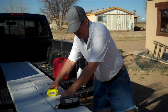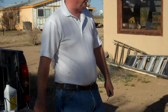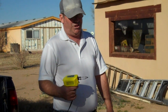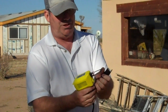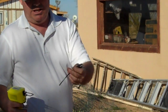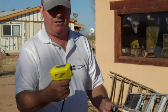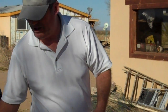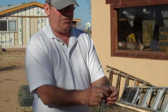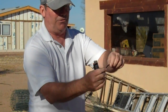Last but not least, when you're in there taking that battery out — or when things are set up and the seat is off and you have access to your battery — a lot of people feel you should go ahead and cut out the fuses and put in a car-style fuse holder and fuse. This one takes 15-amp ones. Slip some heat shrink wrap — you can find that at Home Depot — down the wires first. Don't forget to do that first. Then a normal little $10 soldering iron will do just fine. After you solder it on, move the shrink wrap back covering the weld point, and use a cigarette lighter to heat it up and seal it.